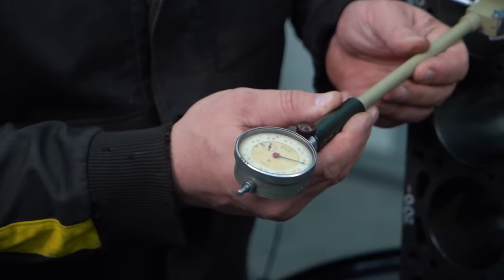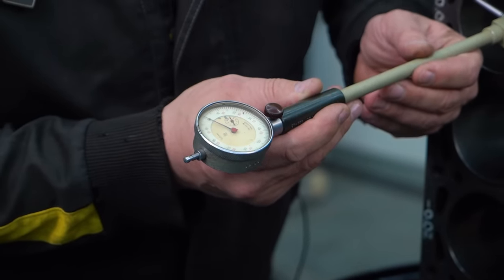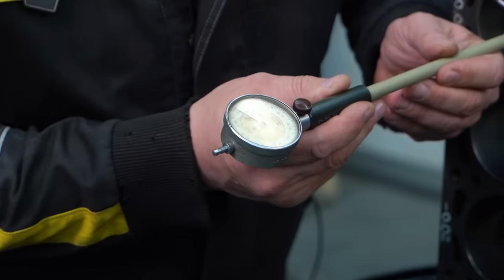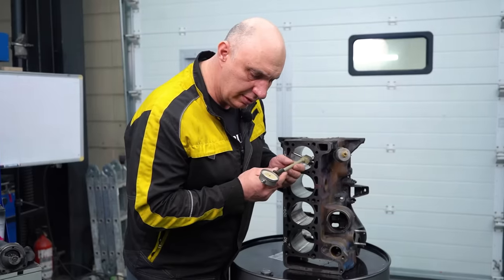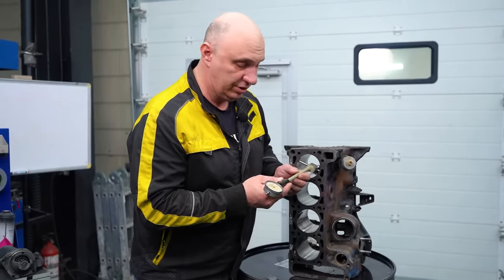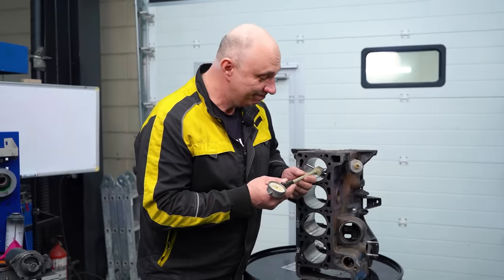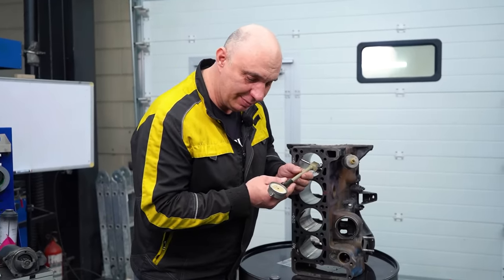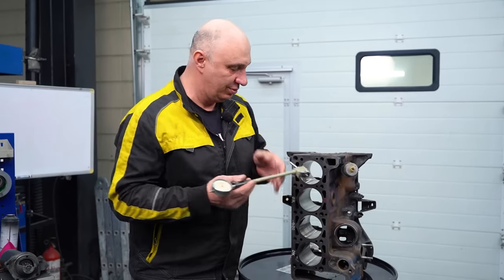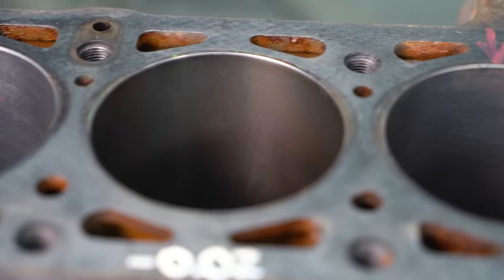Let's stick this gauge into the polished cylinder. We're reading 0.005 — so it's just a bit too narrow, but that's pretty much where we need it to be. It wasn't easy being a manual job. The bore is about where we want it to be, about the same in all four cylinders — the difference being that two are honed while the other two have a mirror finish.